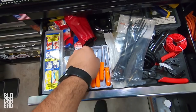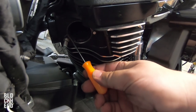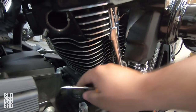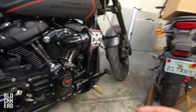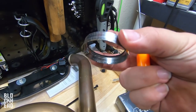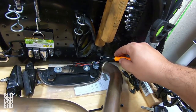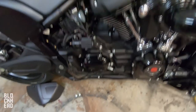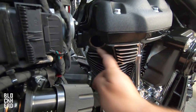Taking the old ones out isn't too difficult — you just need a pick. When getting the old ones out, be careful not to dig into the actual aluminum of the head. The ends of the exhaust pipe are belled or tapered, so it goes in, expands, and crushes the gasket so there's no leak. Since it's already crushed and formed to shape, I don't want to risk putting these new ones on over a deformed surface. Might as well take the old ones off and put the new ones on.